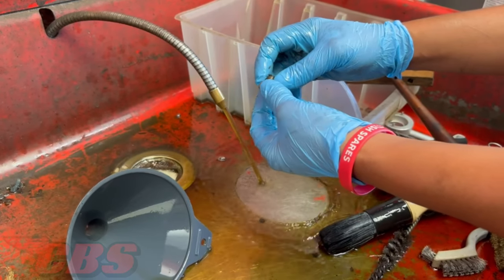We got the drain plug all cleaned up — this is a magnetic drain plug. We're going to apply some Yamabon around the fiber washer. This is probably overkill, but I've had issues with fiber washers not sealing because the fiber washer is very hard and it's not soft like a cork washer or an O-ring. So we're going to put some Yamabon on there and slide it on. Now we're ready to install the drain plug back on the oil tank. There's a little bit of oil still coming out, so we have to move fast. Yamabon — or Permatex Gray or a lot of Permatex products — works really well and seals pretty good even when there's oil contaminants around it. We're going to snug this up; it doesn't have to be crazy tight. There we go — nice and tight.